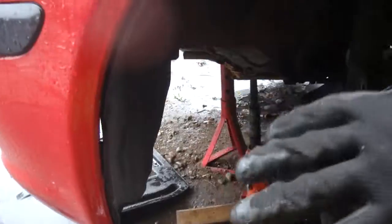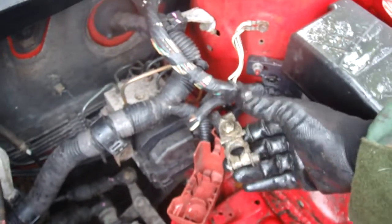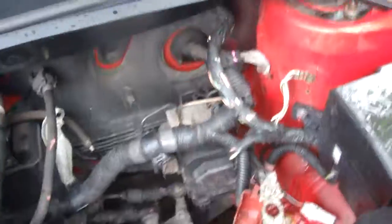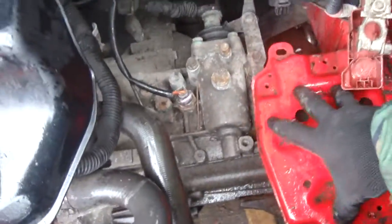I've put a few jacks under there but we're not there yet. So then we come to the battery - take your battery leads off. Negative off first - negatives off first, on last where batteries are concerned. Once you've taken your negative off, it doesn't matter if you touch the body with the spanner against the terminal while taking it off - it won't arc out. So negatives off first, on last - handy little tip for batteries. There are two clamps on this one - one hooks in and there's a strap over the top. Take that off, battery comes out, jobs are good.